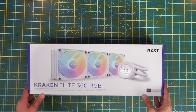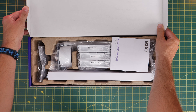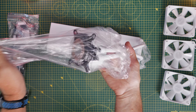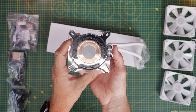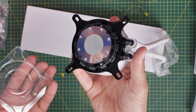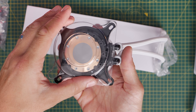This is a 360 mil cooler with a pretty easy setup process. It comes with its own fans as standard, but you can swap those fans out if you want to create a uniform design throughout the case. The cooler comes with pre-applied thermal paste, so you don't need to worry about applying it. It has a protective cover — I'd recommend not removing that until you're ready to build, so that you don't damage the thermal paste, because that can cause problems.